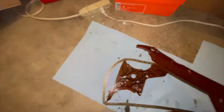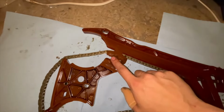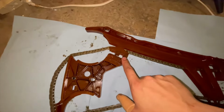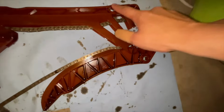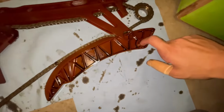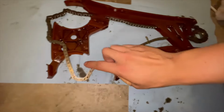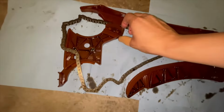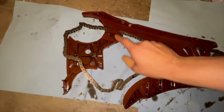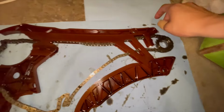All right, got the guide out, and you can see right here where it's significantly cracked, where all the retaining pins for these spots were just worn, like they were polished. The chain itself, I'm gonna check right now. I don't believe it's stretched too bad. It was mainly the vibrations causing this part to break, and it was just literally hanging in there.